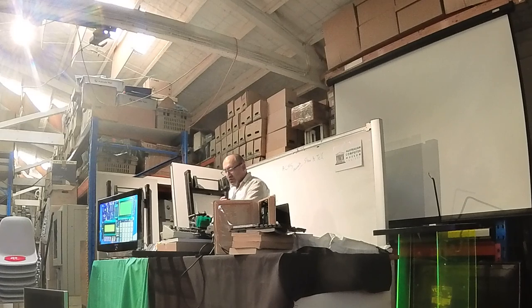With the data entry view, we've got the last 5 bytes going backwards, the current byte you're on, and the next 10 bytes. Underneath, we've got the disassembler of the code. So 46 here, at some random memory location, is load B, the address in HL, to B. And down here it says 4046, so this is the address and the data. It uses a similar concept to all the other monitors.